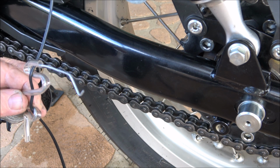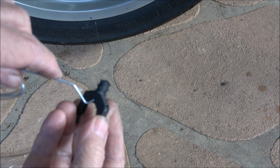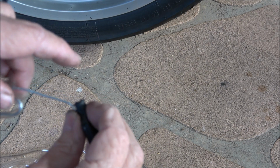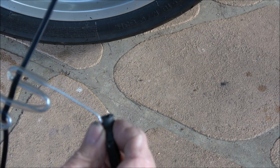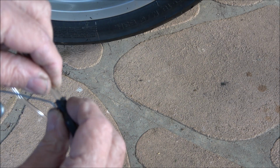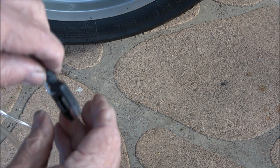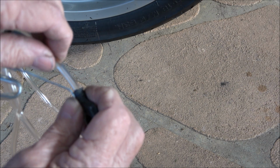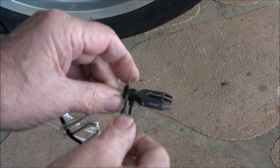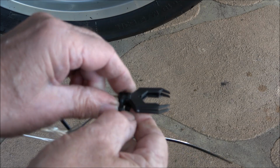On the same unit we'll be taking a look at that wire hook right at the tip here. Thread it through. It'll sit like that. We'll bring our tube feed line in, and we'll slide it in, so we've got them all together like that. Then we'll use a small cable tie to clip it together, and that should fix that up. So that's really your oil feed, so I've just pushed it in tight.